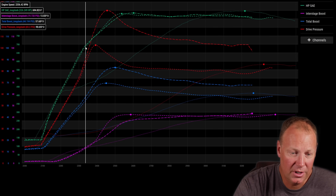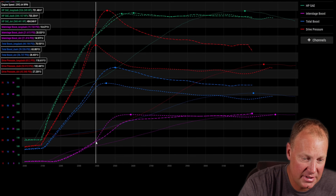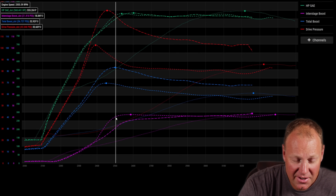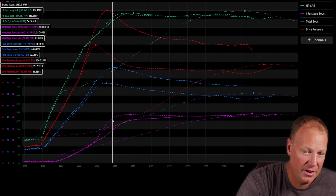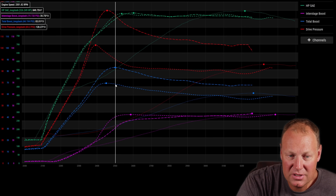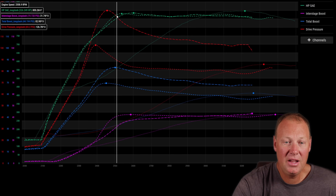What's interesting is we can see the gates open on the middle run and sure enough, when the gate opens the 488 starts going harder. In this run the 488 is taking off and climbing faster than the run where the gate is still closed, because we're putting more energy into the 488. Even though the 488 is taking off, we might be concerned that our boost has peaked and is dropping — but that's not a concern because we're making more power right here.